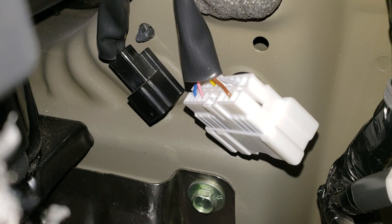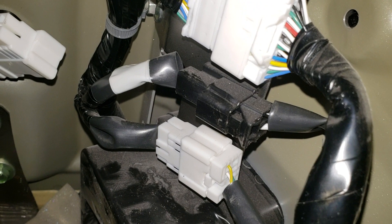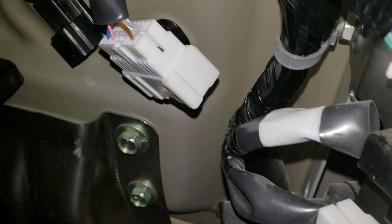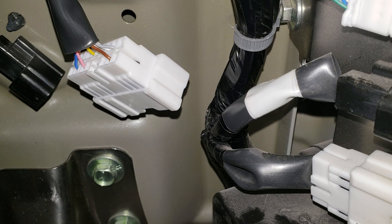Those are the two connectors you're gonna connect into — they're kind of hard to see even at my angle, so sometimes you just have to put your hand in there and feel them. You know it's the right one because they have wires on one side but the connectors are open on the other side. Don't mess with the ones that are already connected to something. They're held in by clips, so you can actually pull those away from the vehicle. The white one I've already pulled away and the black one is still stuck. That's where you connect, and it'll make your installation a lot easier — you won't have to take out the entire trunk like some people are telling you to.